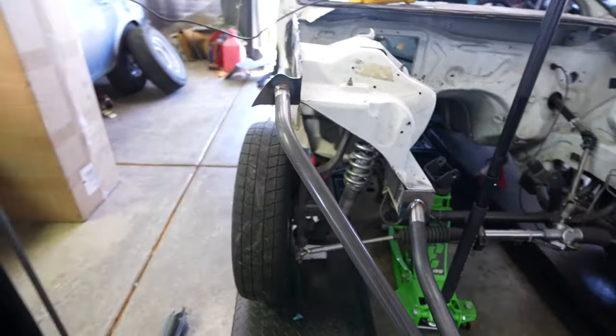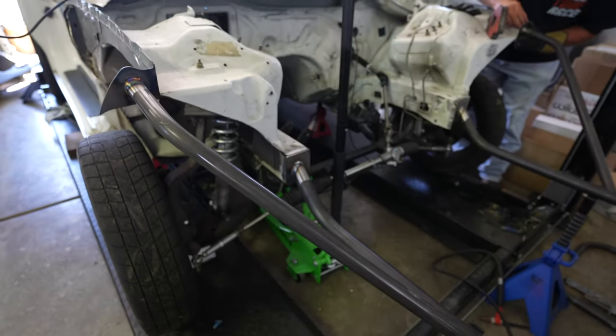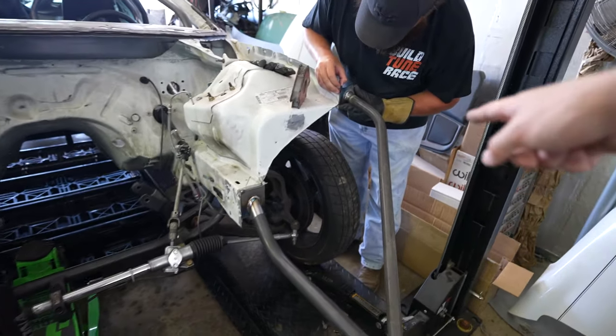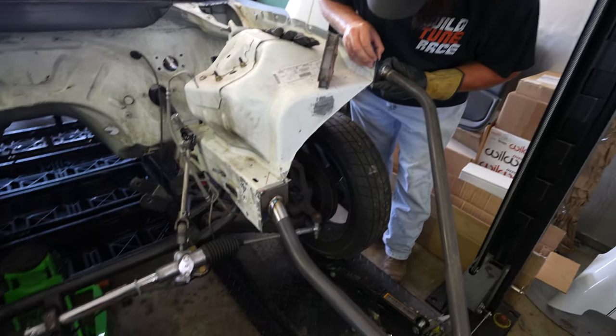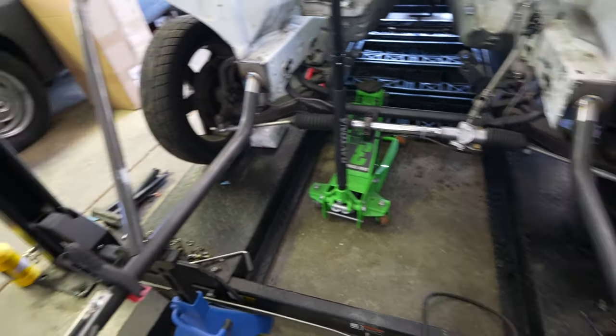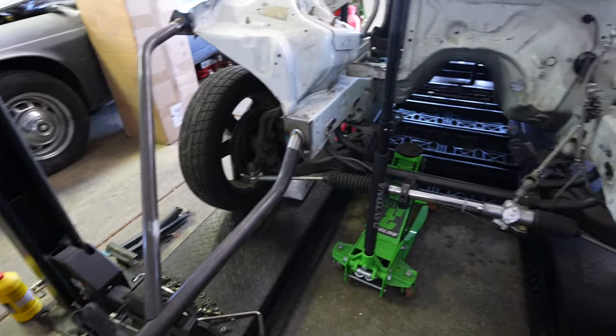A couple of inside tacks there — there's not much material there. This side's kind of in place now. We're going to start putting this bar on there, get that held in place, then tack it. I'm leaving these till later, then we'll get the center bar in and make sure everything's square. Everything can still pull in pretty easily right now so nothing's too solid yet.